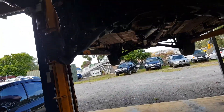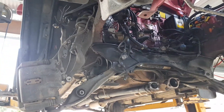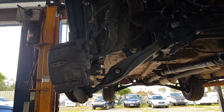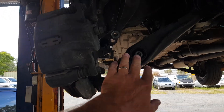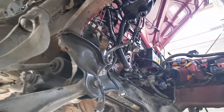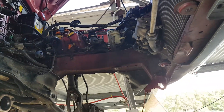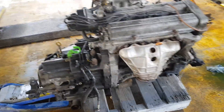I'm going to show you what we've had to do to get there. It was a pretty straightforward job if you can actually put the car up. If you've got to do it on the ground, good luck to you — that's how you spell pain and punishment. But if you've got a hoist, or if you can hire one, get in there and do it. You've got to split this to get the axles out. Once the axles are out it's a pretty straightforward job — there's no crossmember to drop out or anything like that. Just undo things, drop them down, lift the car up and over it. That's pretty much it.